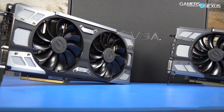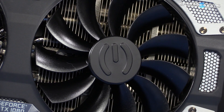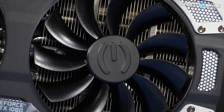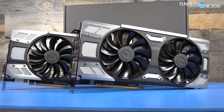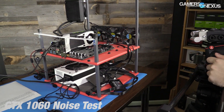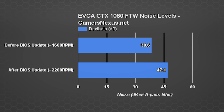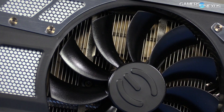We've performed initial dB testing to look at the change in noise output versus fan RPM. The test platform used all passive cooling — the CPU and power supply passively cooled on an open-air test bench with no fans attached — so the only device making noise was the video card. The room noise floor is about 26 dB, already accounted for in these metrics. Noise is at about 38.6 dB for the GTX 1080 FTW before the vBIOS mod, when the VRM was much hotter and fan speed was lower, peaking around 1600 RPM. Post-vBIOS change, simulated by simply changing the fan RPM to 2200 manually per EVGA's advice, is at 47.1 dB — a perceived increase just shy of a 2x gain in volume.